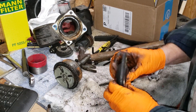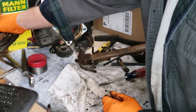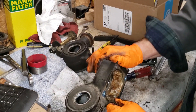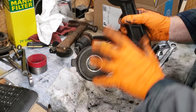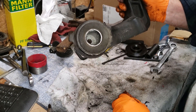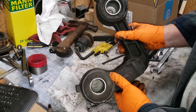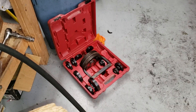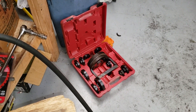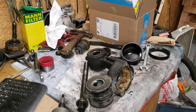We found out where that rubber piece goes — it goes in there. I'm going to leave that in there for now just so I know how that goes together. We're going to set that aside and come back over here to this. I looked online and there is a tool to remove these bushings from this assembly. It's $1,400 for the tool. I'm not going to buy the tool, so we're going to do this by hand, the old-fashioned way. I've got this Mercedes/BMW wheel bearing hub removal kit — I'll commandeer certain parts from it to try to push these bearings out of this carrier.